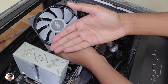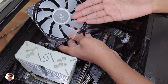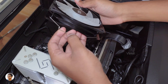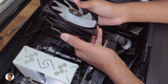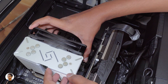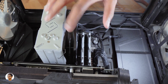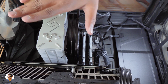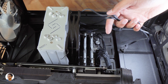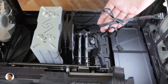Now next we need to install the fan on the heatsink. This heatsink supports installation of two fans on both sides, or you can install just one — the choice is up to you. I'll be installing only one fan for now because I'm a bit short on RGB headers on my motherboard. Installation of the fan is super easy — you require no screws at all and there's no complication involved. These fans come with two hooks that you fix into the provided holes, then just place the fan in front of the heatsink and clip it on with the hooks. We've fixed the fan on the heatsink and this is how the metal clamps look after fixing them properly. Now all that's left is to connect the cables to the motherboard — two RGB cables go to the RGB headers and the fan cable goes to the CPU fan socket. And that's it, our new CPU cooler is ready to be used.